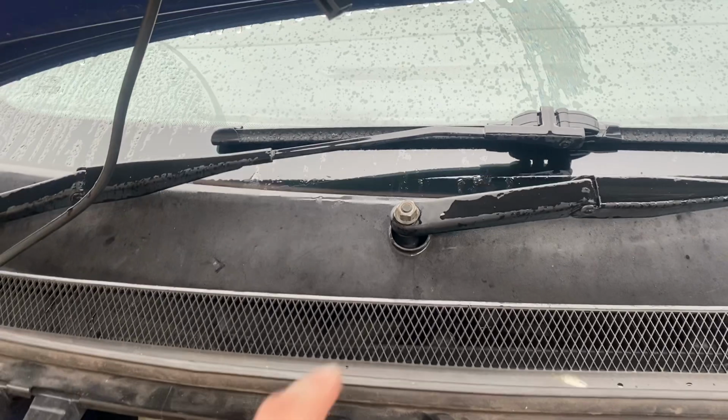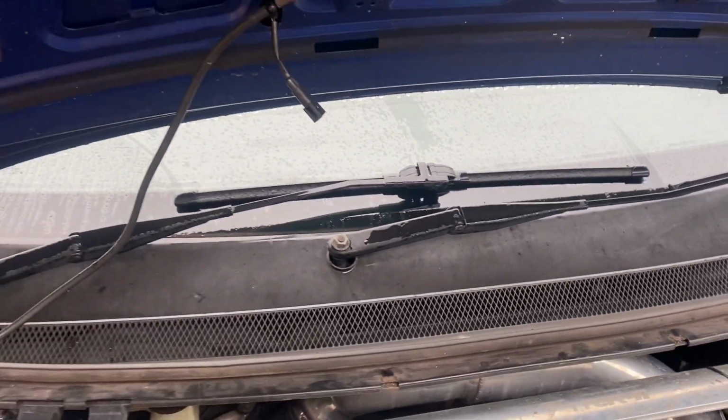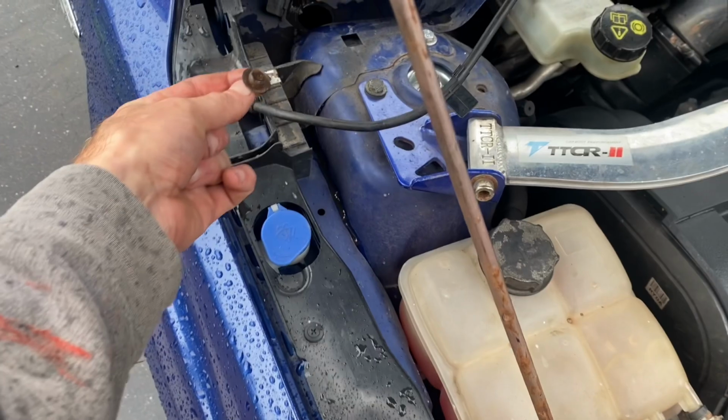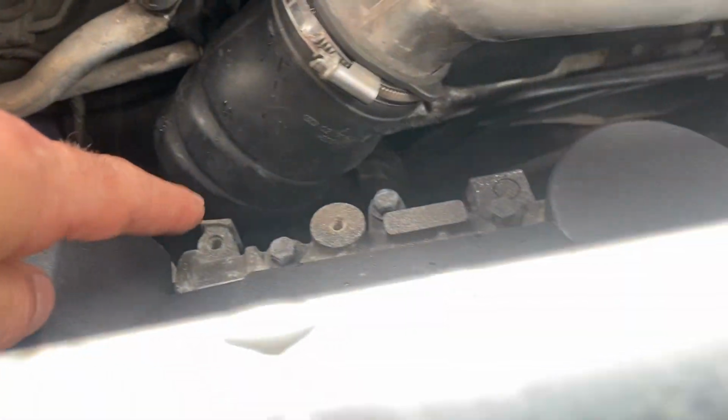As it is raining, I realise, just always reset your wipers to factory, otherwise they're going to be going ping over the other side. For reference, these are T30, okay? Put them down there. Don't forget to put your wipers left and right. Slacking this off now, which is the 7mm, and the next one down. Right, it's belting down now, and the DPD man ain't here yet.